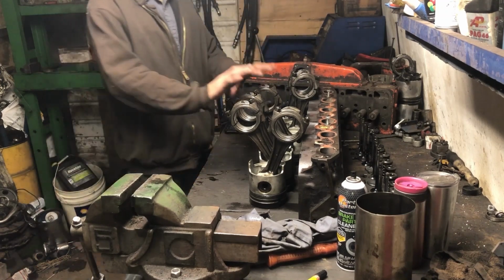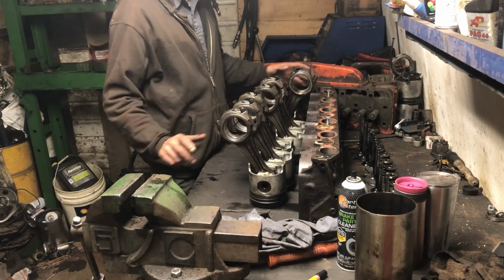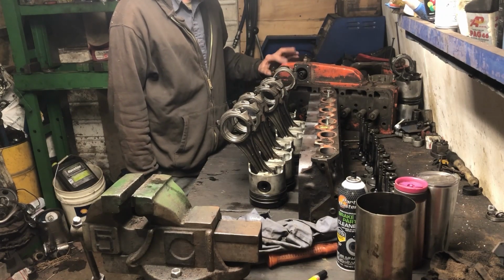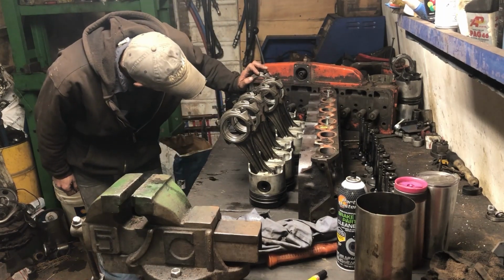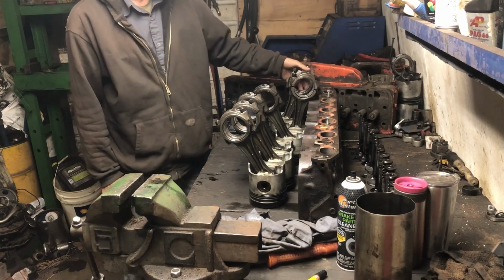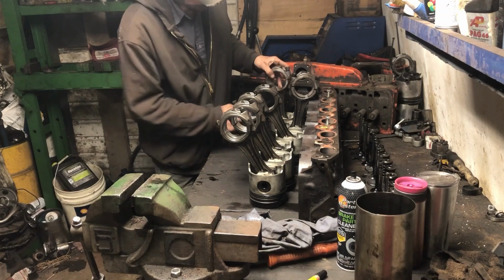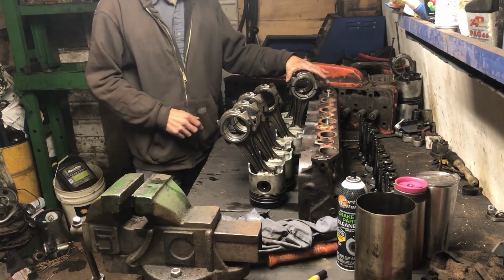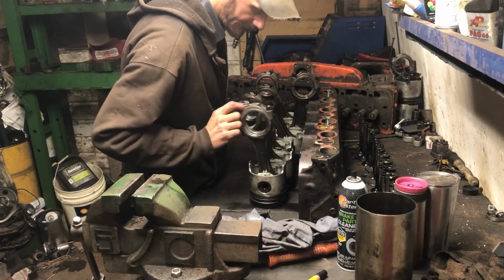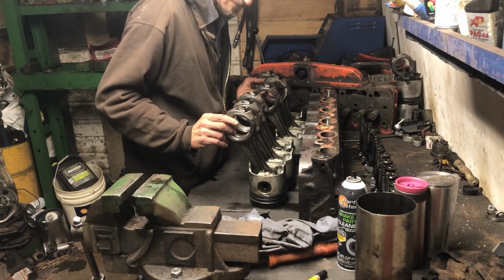So these three that are swung this way are matching. This one's different from everything. This one's different from everything. And this one, well, it's the same part number, but the cap is backwards. The whole rod is backwards. It's machined backwards. You turn it this way, it runs all the same, but it's machined backwards. So really, what we have is a completely separate rod, and I'm pretty sure one of these is, and maybe both of them are, aftermarket and different aftermarket.